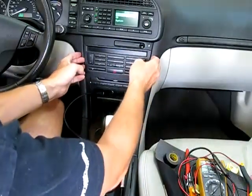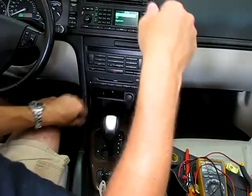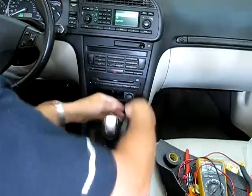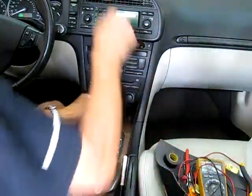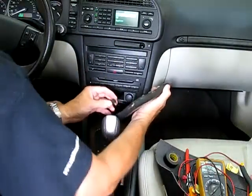I just thought of something — I've got my key in the off position but I still have power. I probably should have plugged those in with everything off. It's working now, but it's not good to plug in connectors with power on. I'm going to wait to push the climate control back in all the way because I want to get the GPS piece installed first, since that's one of the harder pieces to remove.